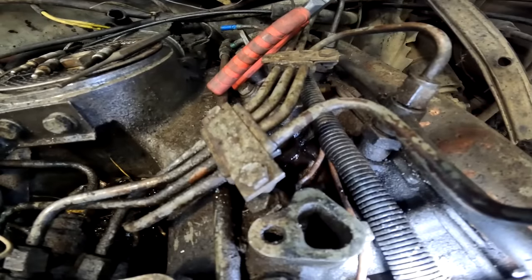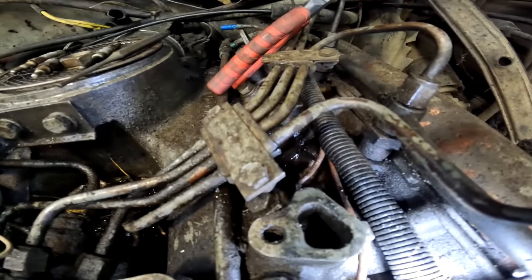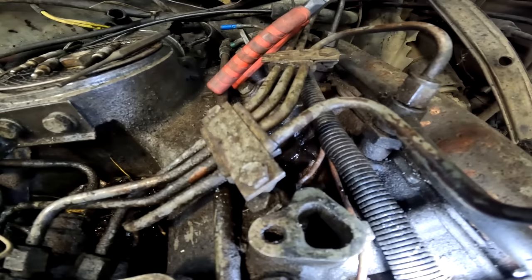All right, so what's happened is one of the glow plugs has exploded because I'm stunned and I probably left them run for too long, and the end of it is stuck in the hole. These are my 3 options. Pull the head and do everything properly. Nope. Try to fish that out of there with a punch or something, but then it runs the risk of dropping in there like all the other ones did. Or I can just crank it over and see if it fires itself out after she gets a compression stroke.